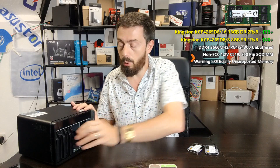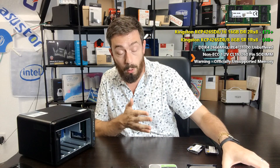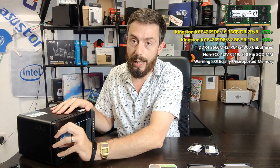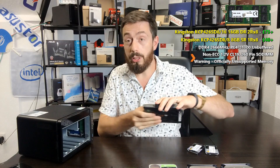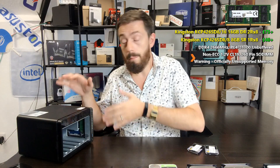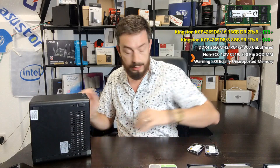For this test I have already pre-installed QTS inside this device, set up a bunch of apps, and already configured the RAID across all the hard drives. After that I'm going to go ahead and install this memory — I've powered it down. Just make sure you've got your software already pre-installed. We're not utilizing this six-bay for the demo; the four-bay over there — I've just heard a beep, so I think that's a good sign that it works — and we're going to install our 16GB module now.